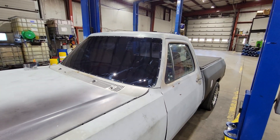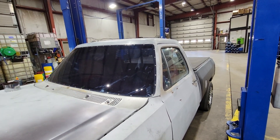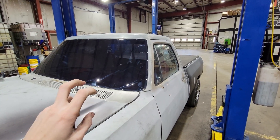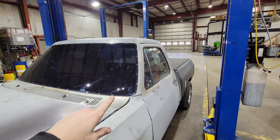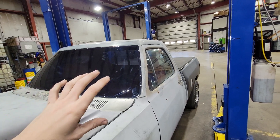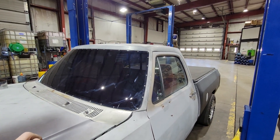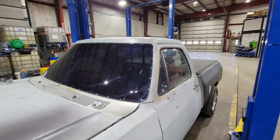I've used over 40 of them and I need three more. I'm going to pull it back off, trim that bottom corner about a quarter inch more, and it'll be completely good. Then I'll get some 3M windshield sealer — I don't know exactly what you'd call it, but it's what we used to use on windshields where I used to work — put that on, bolt the Lexan back down, and it should be watertight. I also think it kind of accents the shaved drip rail. A couple guys mentioned on my story last night they never even realized this truck had a shaved drip rail until I put this windshield in.